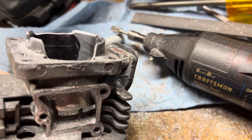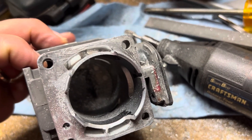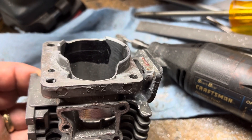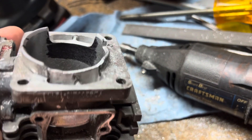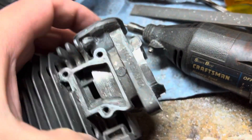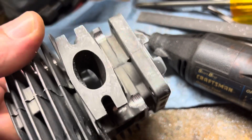I did open up the transfers a little bit on both sides, already done that. Now I'm just lowering this — I'm probably going to pay hell when I put the rings on — but I just wanted it a hair lower, wanted to make sure it actually got in there pretty well. This one's beautiful, it's going to be so easy to do transfers on, put the uppers where you want them.